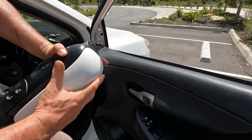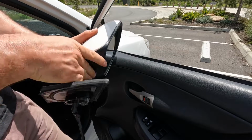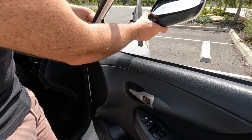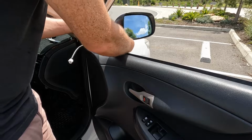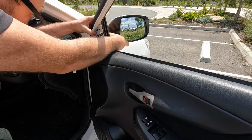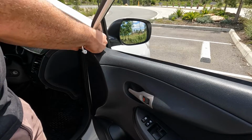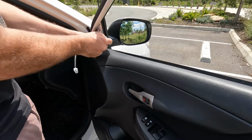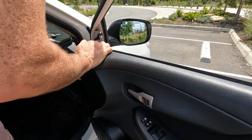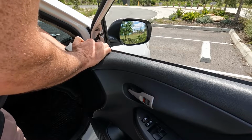And then once you've got your new wing mirror and you've got your colour right, just going to start by pushing that in first, and there we go, I've got it that time. Just making sure it's sealed all the way around like that, and then we can go ahead and start to put it back on the car. So again, I'd like to do it just in the same process, just lining it up from the outside, keeping a hand on there for support, lining up everything on the inside, and then of course starting to get the bolts in, and I would always urge you to get the top one in first. There you go, no need to do them up too tight, and then of course we're just going to put that electrical connection back in, making sure it clicks all the way in.